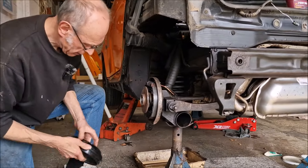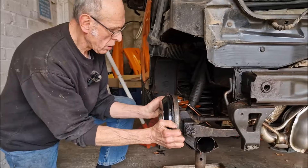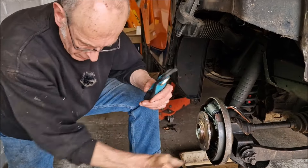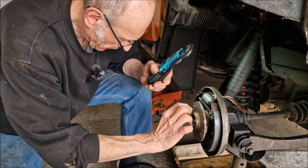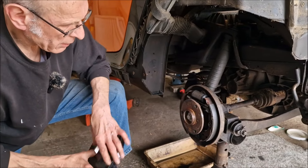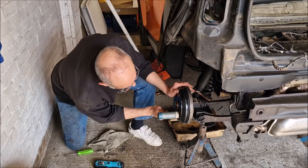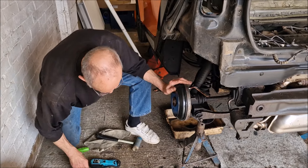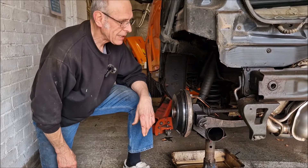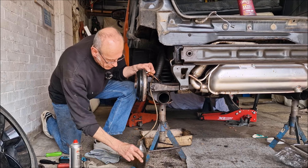Let's see if that drum fits. We've cleaned and actually painted the drum. The drum cover wouldn't go back on because it was adjusted too far over, so we've wound it back. Now we're greasing the hub — it's spot on. We get the screws and bits together, hit the drum just to make sure it's settled properly, and now we need to bleed it.